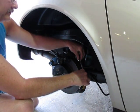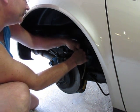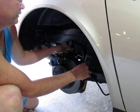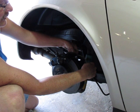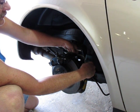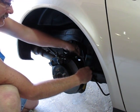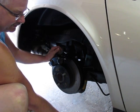I'll go ahead and do the other one just to show it. I usually start at the right rear on the outside and then work my way to the inside. Here you pretty much have to use the open end of the wrench because it's such a pain to get on it. Once you get it loosened you can just turn it by hand. You can see the fluid come out — there's a tiny little air bubble there. This one here is just a trickle; you can see there's no air in the system. I'll bring it back down, tighten up the bleeder, remove the hose, and wipe off any residual. And that's pretty much it to bleeding the brakes with one of those pressure bleeders.